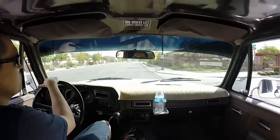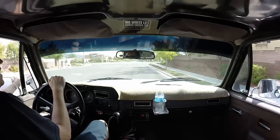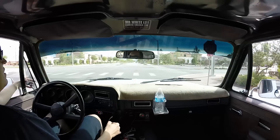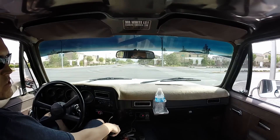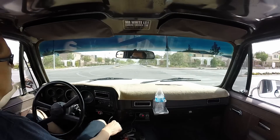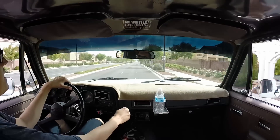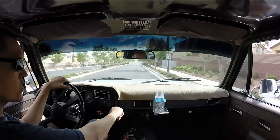Gonna be a perfect day for a little road test - kind of rainy on and off, about 72 or 73 degrees. I took that road test last night and the pedal's feeling pretty good. I still need to do a proper bleed on it because I think I can get it to feel a lot better, but I was able to make a lot of adjustment to the rear so we're getting there.